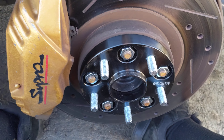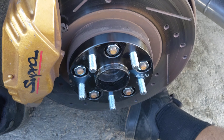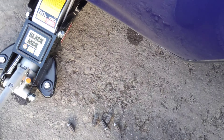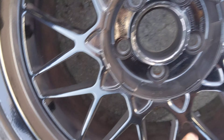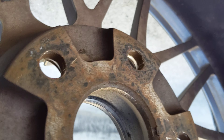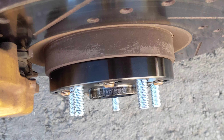The solution to that is to get a bigger spacer, so if I want to run one in the rear, do like a 25 mil to kind of make it flush. The rear is 18 by 10 plus 50 and the fronts are 18 by 9 plus 42. These will fit fine — my rears, technically, would fit fine if I had different wheels, so this is very dependent on your wheel setup. Up here my wheels have this little arch gap dimple, whatever you want to call it, between each spoke, and it will not touch — as you can see it's like a mil, it's a lot deeper in the front.